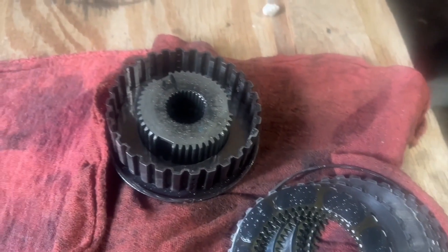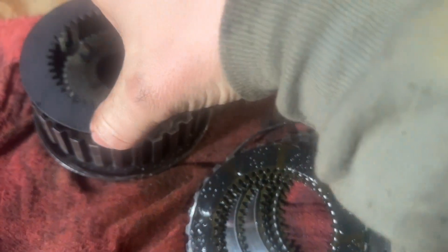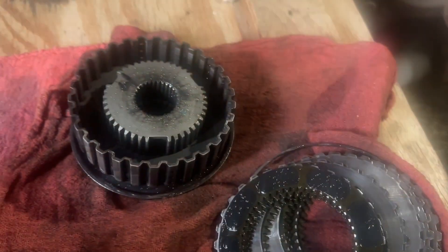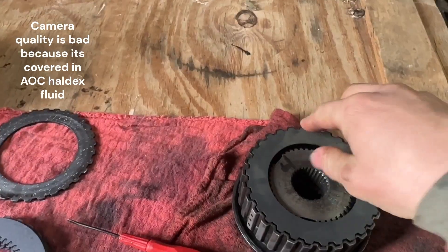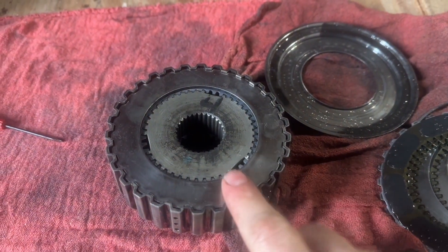I have one new CL piston in the bag, so I'll insert that off camera. I've taken the rest of this inside because it started raining. Make sure that your first thick plate — the stock one — goes in first. Set it right in the middle. Now we start stacking our plates. I'm using the stack we made at the beginning of the video, alternating thick plates, friction discs, and thin plates, and just reconstructing it inside the assembly. Once you're done stacking, put on your last thick plate up top.